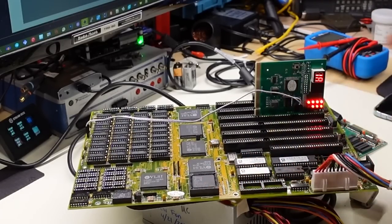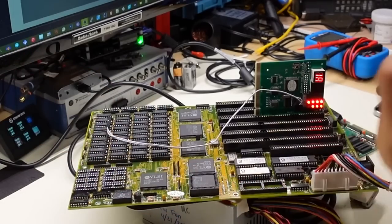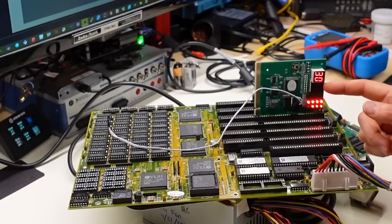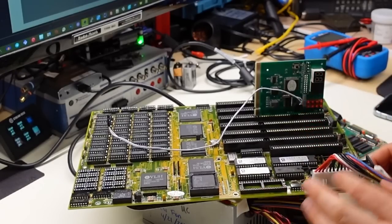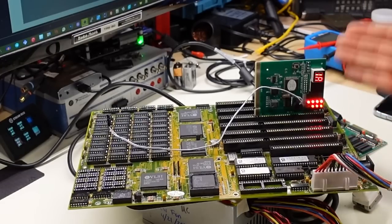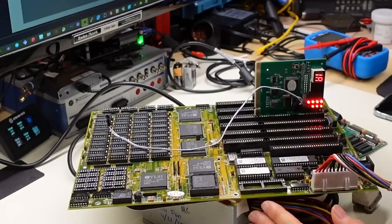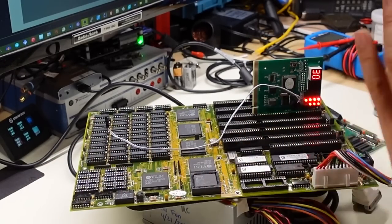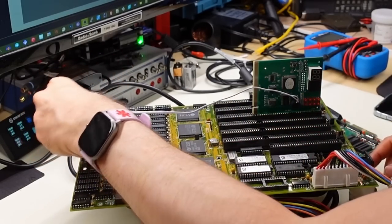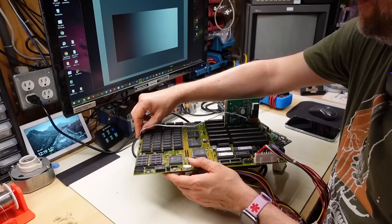The power supply is ready to go, postcard is turned so the codes are visible, power connector is connected, no cards are inserted. Here we go. Great sign, everyone — if the processor weren't running or the BIOS chips weren't in there, you would not get anything on here. It would just say dash-dash, which is what it did when I first turned it on. I'll turn it off and back on — for a split second you'll see dash-dash, and then the codes start, because this displays dash-dash until the BIOS writes to that I/O port for the post code. It's reading 1A, now 30 — this computer is trying to work. The beeping was almost certainly because there's no video card.